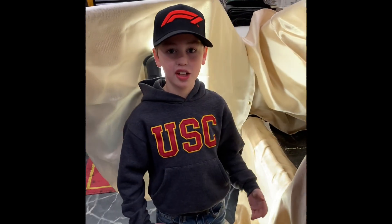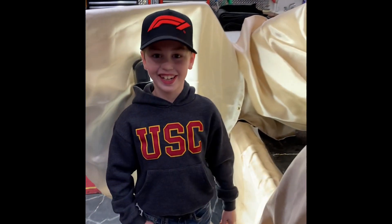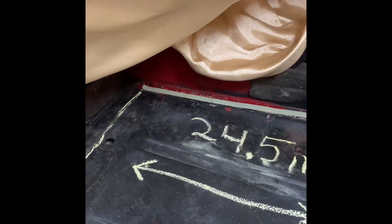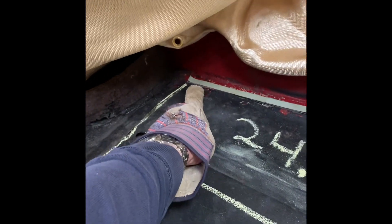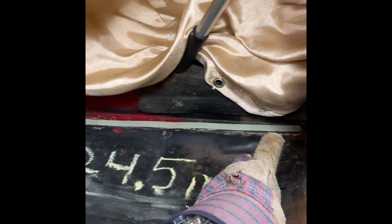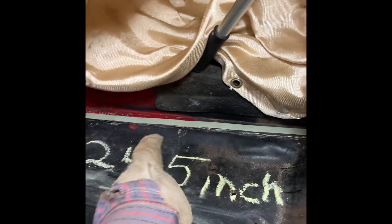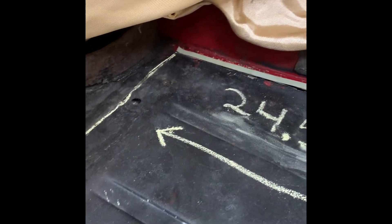After you are done putting on your heavy duty welding sheets, you're ready to cut. On the driver's side, you want to cut a quarter of an inch from where the shift tunnel spot welds are — the overlap. I use quarter inch tape and I just follow the edge of the shift tunnel sheet metal.